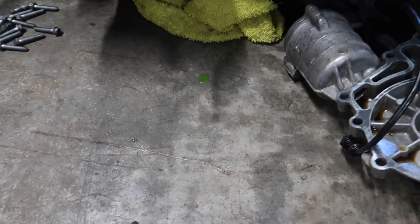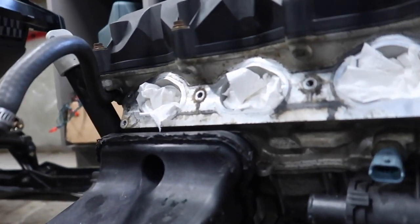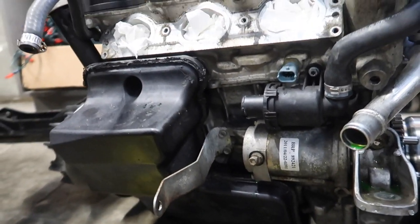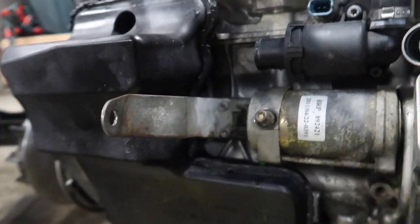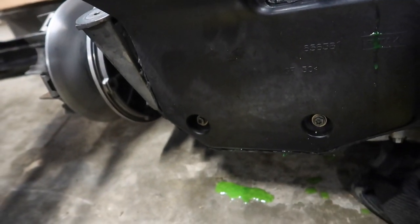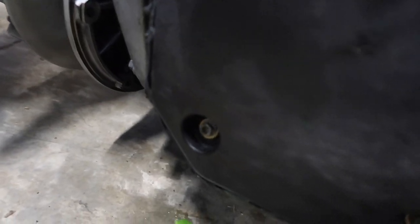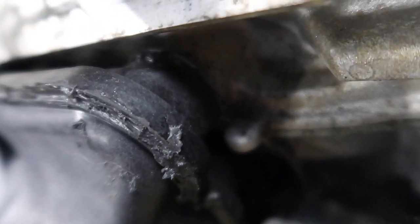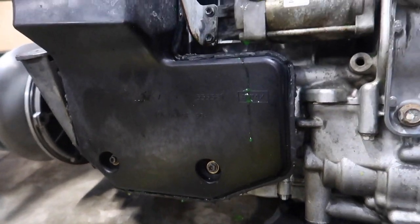Now for oil leaks — this is your oil tank right here, behind your sled, hidden there. Tipping it up, you can see the tank has two bolts here, and I believe there's an o-ring right here that goes in behind, and one up here. As you can see there's caulking everywhere — Permatex 'The Right Stuff.' That's what I used and it's really good. Your common oil leak will be coming out of the bottom of this tank.